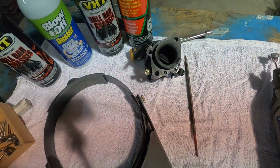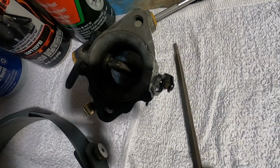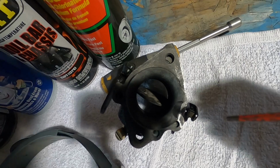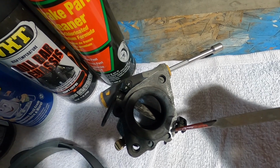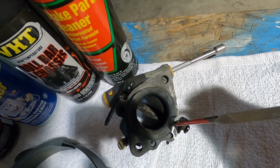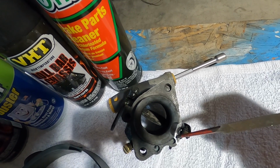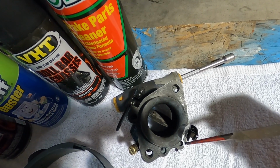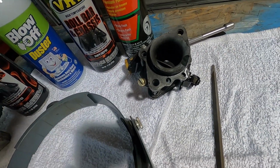One last tool that has come into existence for this particular carburetor. I'm rebuilding a carburetor for a friend in Tennessee, and you might be able to notice a file mark. I have some white paint surrounding it. I've already cleaned up this base and painted it, and I made a white mark around a burr that I found on this base. The burr is right there. You can possibly see that it's been filed down. So a good three-corner file would be a very good thing to have.